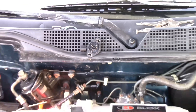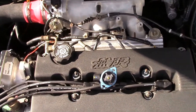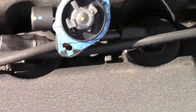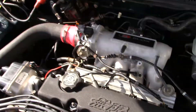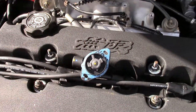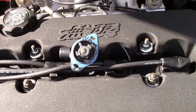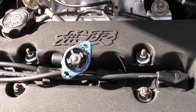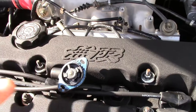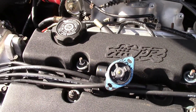Old sensor is out — nothing visually wrong with it, but I know I've been having an issue with it. New sensor, new gasket, new hardware — the whole deal. You see how these prongs are? That aligns back in here. There's a little bracket this has to go on one way; if you don't get it on the proper way it will not calibrate properly and you'll have all kinds of issues. Clip it into the clips properly and screw it down. The hardest part is calibrating them — luckily I have Hondata so it's easy.